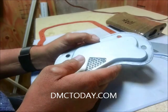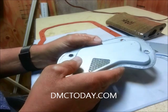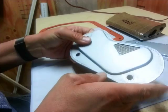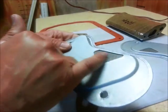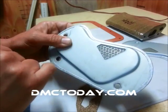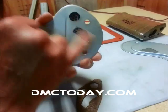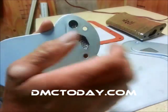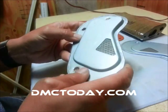Since the company went bankrupt in '82 and all production ceased, there were not very many of these things floating around to begin with. In fact, Peugeot, which I believe made the original filters for the car, actually screwed up one batch in which the mesh plate — this real fine metal mesh — was placed in behind the baffle plate, the reinforcement plate behind it. The order was reversed and the mesh was on this side, which is the part that mates up to the valve body, and it actually got sucked up into the valve body, ceased the flow, and burned transmissions up. So even then, they were having problems with them.